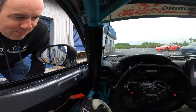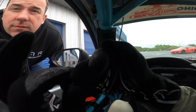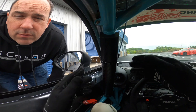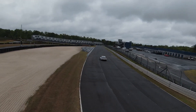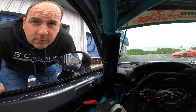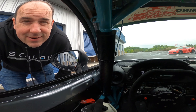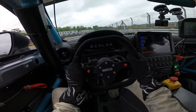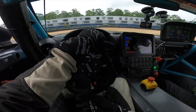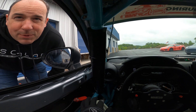You started to notice some body roll in the dry? A little bit — it was too oversteering. So I figured since I'm feeling a little roll, let's go stiffer front rather than softer rear. It could kind of go either way. So that's what we did. I like the feel of the steering, especially for an electric. And I can do quick corrections — like when we have the snap oversteer — and I don't beat the steering, it keeps up. That's really important. I like the steering, it's mechanical, just a small power assist really.